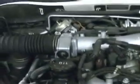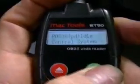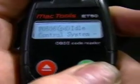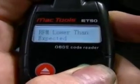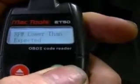So, anyway, let's find out what's going on here. Okay, this is the code that we have. P0506, idle control system, RPM lower than expected. And as we saw, the RPM is not correct.